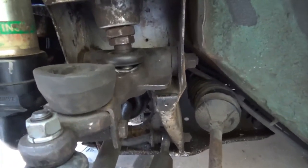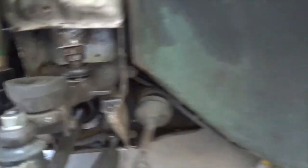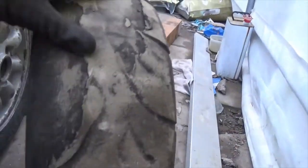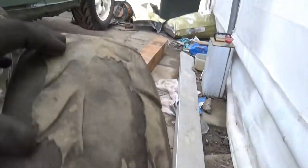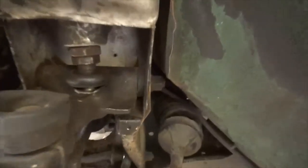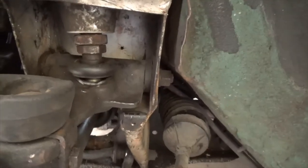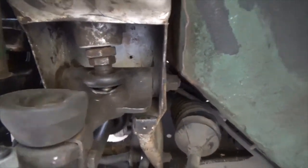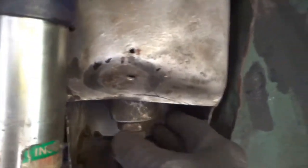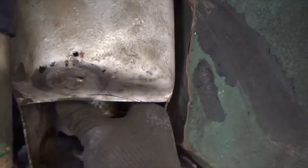Ours had just disintegrated at the last race — you've seen the tyres. It totally put our suspension out and that's what it cost us in tyres. The bump stop was actually there, it was just in that bad of condition and had moved out of position with being hammered around. It also lets the cone on the hi-lo sit loose, and then it gets out of location and affects the ride height.